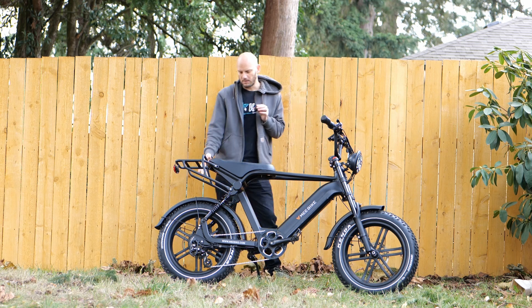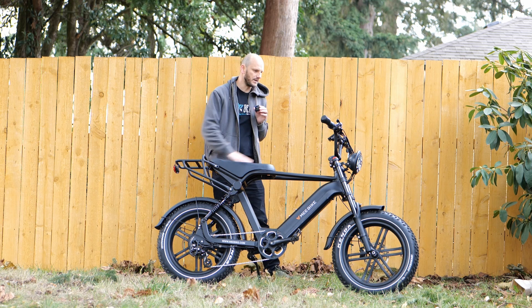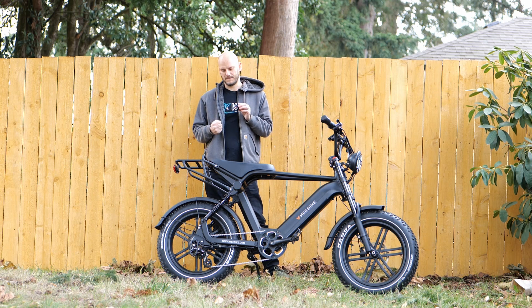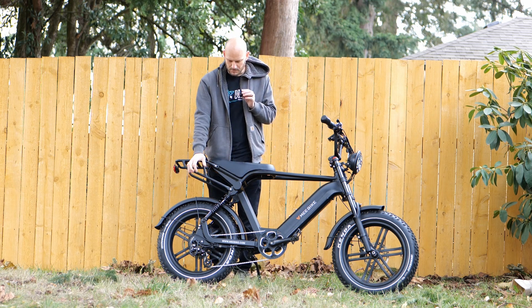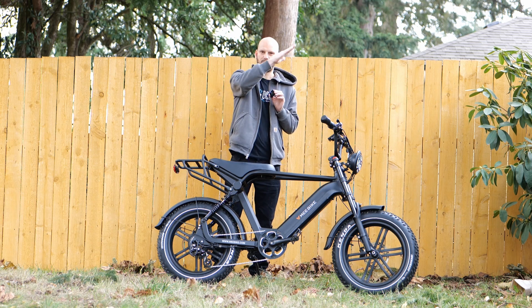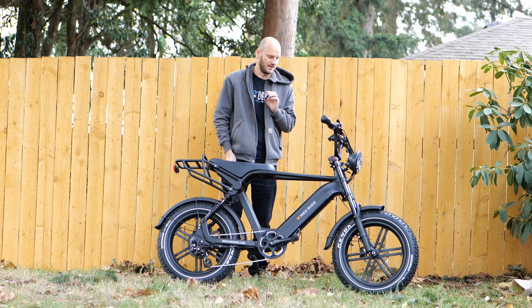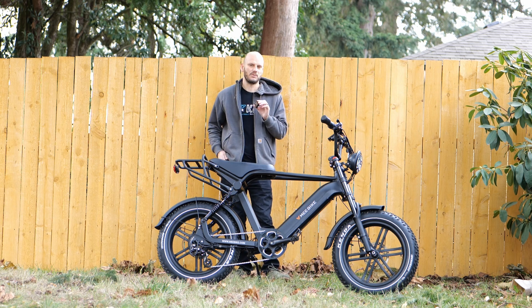So you can see, obviously, it's a hub motor. Hub motors are not the greatest at hill climbing, especially from a standstill. If you get a running start they're a little bit better, but they don't have torque — they're not built for torque. If you need monster hill climbing, you need to go with a mid drive. Hub motors are great for light inclines. The hill I just climbed — that's a crazy hill, probably 30 to 40 degrees — you probably don't have a hill like that. It took a lot of runway to get up and I just did that with throttle only, no pedaling.